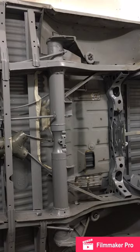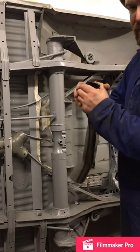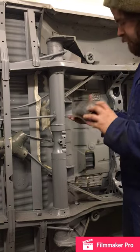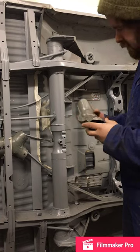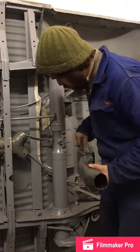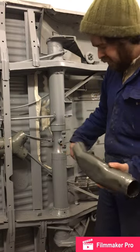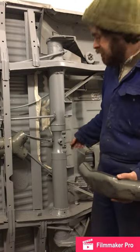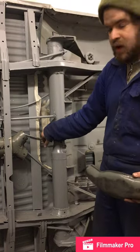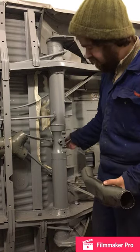Then we've got the other pieces here. I've cut little notches on it slightly just to give me a bit of compression, to make it a bit easier to fit. I've labelled these because I keep getting it wrong. The only way to do it is to do this middle section here, which is slightly lower, and get it over the rest of the torsion bar and through. The other thing I've had to do is chop out the spot welds holding the clutch cable guide tube, otherwise you can't get both pieces in because of a bit of movement.